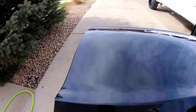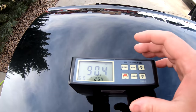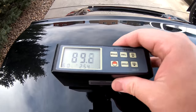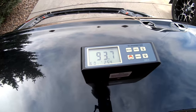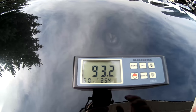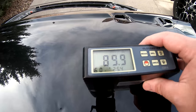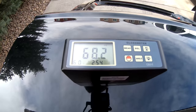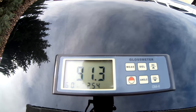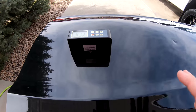They claim that it enhances shine, so let's go ahead and get a reading. We're at 89.4 on the side we haven't done anything to. 91.3, 93.1, 92.5 — those are the readings on the paint corrected side. Come over to where we just foam cannoned and washed: 91.9, 92.1, 91.9, 88.9, 89. So enhancing shine — to the naked eye, with those gloss numbers from the paint corrected side to the side that we used the product on, you're not going to notice a difference. Really not any slickness on the side it's used on compared to the side it's not. So here we are 24 hours later. Let's get some gloss readings: 90.4, 89.6. Over here on the side we did not apply it to: 93.7, 93.2, 89.9. There's really no difference at all.